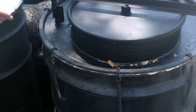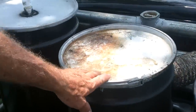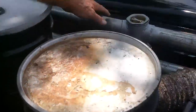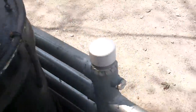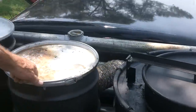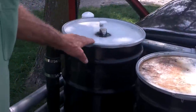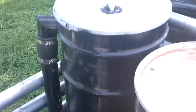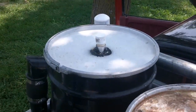This is the gasifier. From here it goes over to a filter and heat exchanger, then up into what I call a radiator system. It looks like sideboards on the truck, and goes underneath the truck to a settlement area. By the time it has gotten to that point, the gas has reached its dew point — you start losing water out of it, and I trap the condensation under the truck.